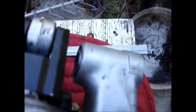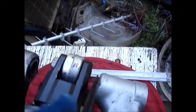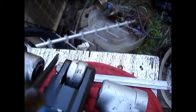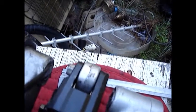Now this is the inner. There's a seal in here. The seal needs to be replaced. The seal wasn't properly installed because it's slightly tilted. On the right side, the depth, I can put the screwdriver in further, right? So there's something there. And this is the right side that has this 0.220 gap. So this is a piece of exposed axle here, and then the engine, and then this gap here is some number that I'm arbitrarily saying is 60, 80 thou.